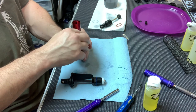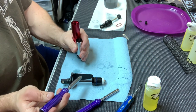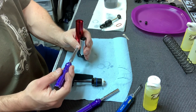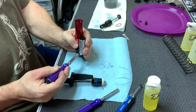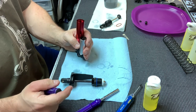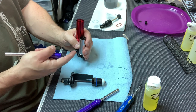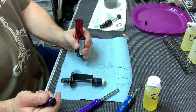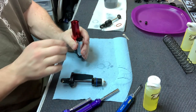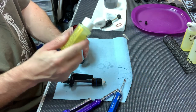Sorry about that — that's my hot water tank. Anyway, I left the piston all the way down because the spring will last longer. Unless I actually built the shock four times with the piston halfway in, I'd never really know the difference — so to me the spring will last longer and we'll be good. We seal this up; the o-ring is already on. There's a little screw with an o-ring that goes in last. We can now top up the oil to the threads.